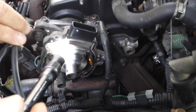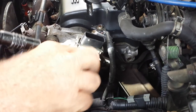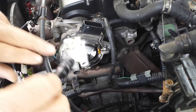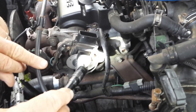Around the edge of this are little tiny squarish holes. They go through here, and it's like on a CD player where the laser looks at stuff. These little holes have to line up perfectly. It looks like a solid piece of something here, but it's actually little tiny holes that go through there. You can get dirt on this thing, and you need to spray it off with some carb cleaner or something like that.